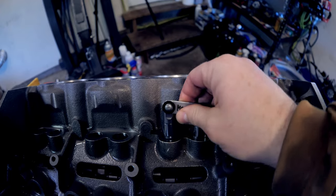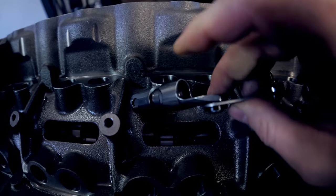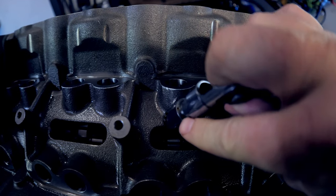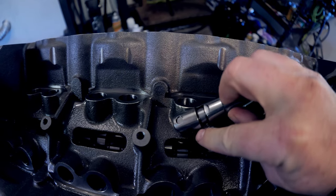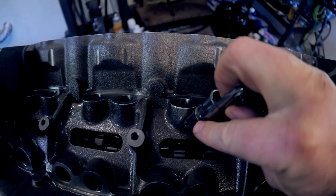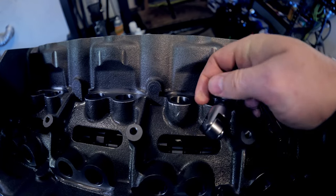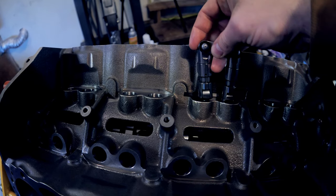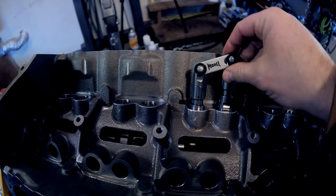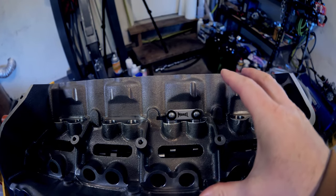That's why when I got these lifters, there's a little hole right there and a small lift-up right here. What that does is add full-time oiling to the needle bearings in this lifter. They also have a bushing style which is better, but those are about $900 for a set. Since I'm not running a ton of spring pressure, I'll take my chances with these.